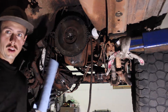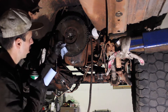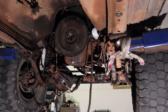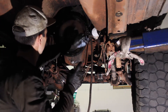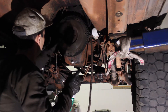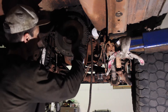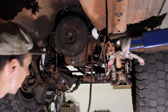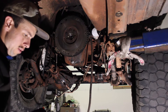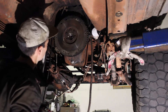Now's a good time before you assemble everything — you're gonna want to clean off your flywheel and your pressure plate. These friction surfaces, you don't want them covered with dirt, oil, and debris. Grab yourself a rag and a can of brake clean and go to town. Try not to hit your pilot bearing if you can; it's not the end of the world, you can re-grease it. This is a used flywheel so I'm just going to spray the rag and then use the rag to specifically wipe where I want to clean instead of spraying all over and having all that old stuff run down.